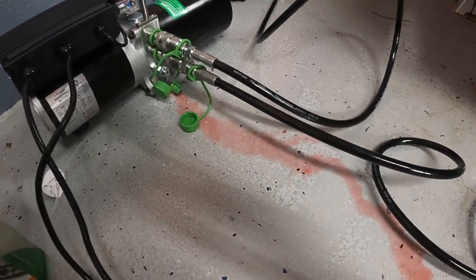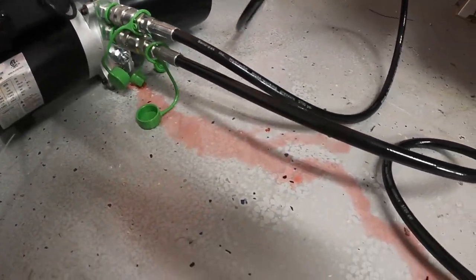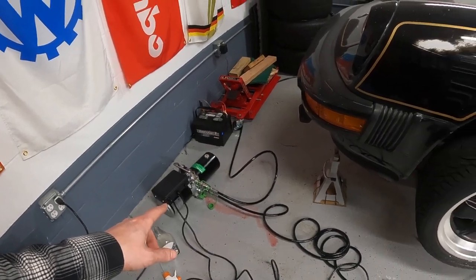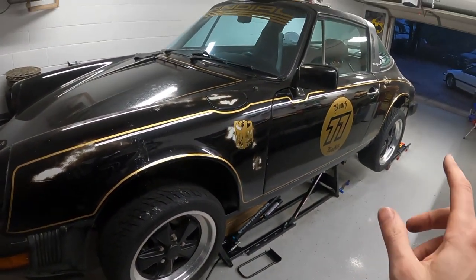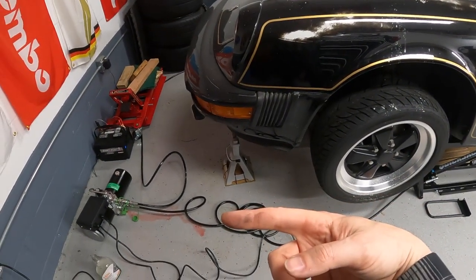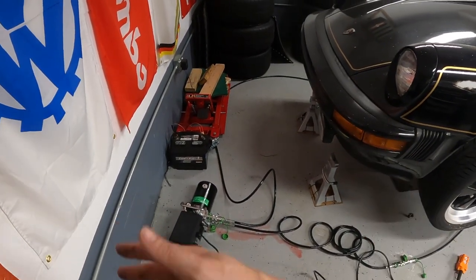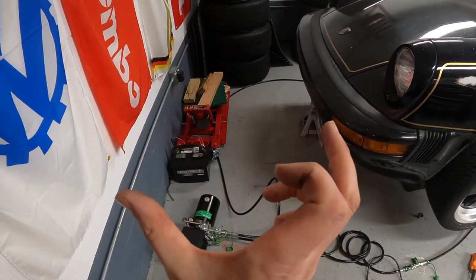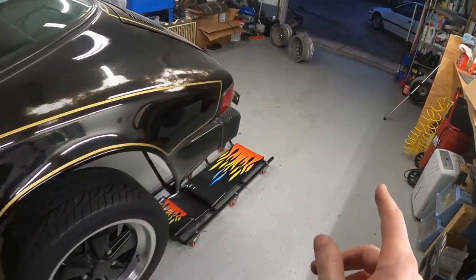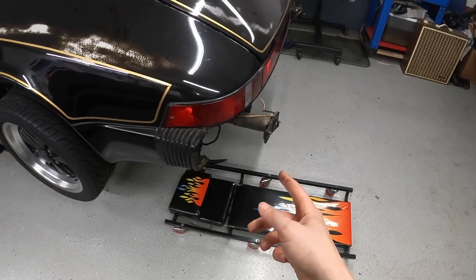In terms of the quick jack, I did notice something I haven't looked into yet — I'm guessing I need to tighten a fitting because it looks like we're leaking a little bit of ATF here. I also want to move everything forward a little bit because right now I don't have much space back here — when I'm parking the Civic in, it's going under the bumper supports of the 911.